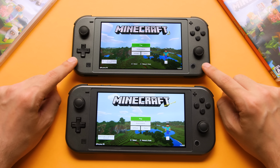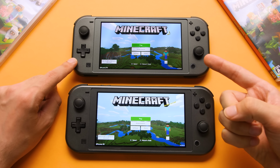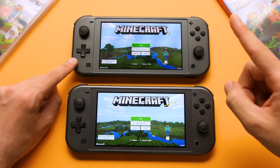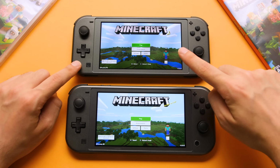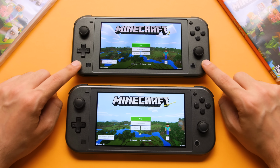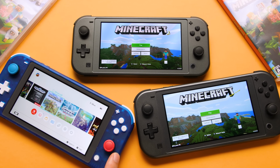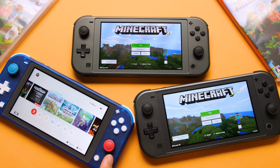When I originally teased this screen at the beginning of the year, the main benefit that it had over the stock screen was better contrast, wider color gamut, and slightly better brightness. The current version is much better. When it comes to brightness, the current screen comes in at 600 nits. To put that into perspective, the stock Switch Lite can only get up to 400 nits, and my transparent blue Switch Lite with an aftermarket OCA plastic touch panel comes in much lower at 268 nits.